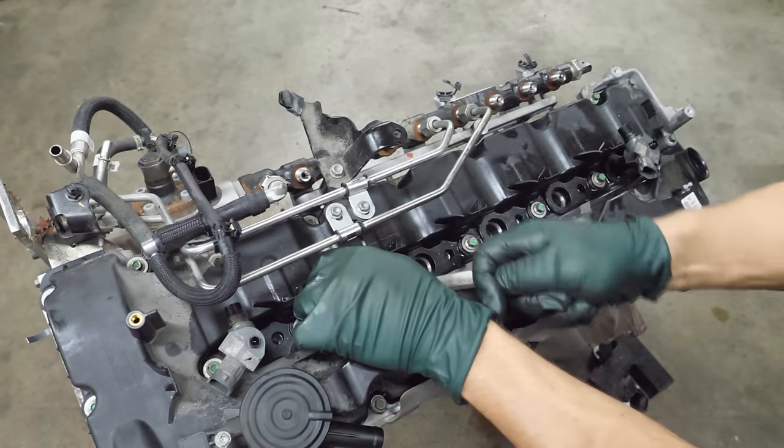That is very loud — this is the loudest flex plate I've ever encountered. I think I'm going to do the upper cover first. The upper cover looks pretty good. I think this one needs oil pressure here — I can hear that. The upper cover is off; this moves pretty freely and that tensioner there might be oil-pressure fed. Next I'm going to remove this lower cover; it just has a couple of 8mm bolts. Now it's time to pry this off — they leave you places to pry. Look at the size of that rear main seal.